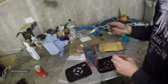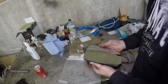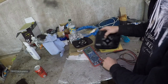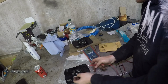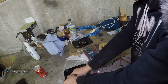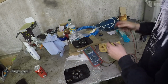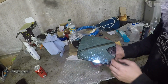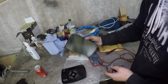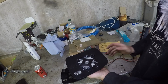So I'm getting from cold 9.6 ohms on the working mirror glass. Well, I'm assuming working, it's brand new. On the non-working mirror glass, have we got any continuity? Yeah, 600 ohms. So that small amount of continuity, if you do your Ohm's law calculation, is basically no heat. Versus this at 12 volts is a nice bit of heat. And I can imagine that resistance will go up as it warms up to reduce the current.